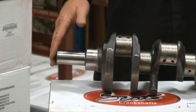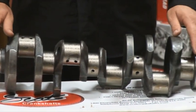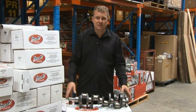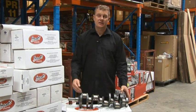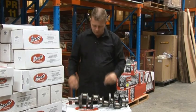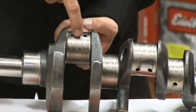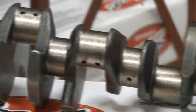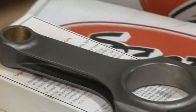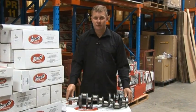This kit here actually takes a 302 Windsor up to 347 cubic inches — that's nearly 50 extra cubes. They increase capacity with a different crankshaft because they increase the stroke: the amount of travel the piston moves up and down in the cylinder bore, by increasing the distance between the centerline of the crankshaft and the actual journal, which also increases the leverage point. It's not uncommon these days to see a small block engine taken up to beyond 400 plus cubic inches, and you wouldn't believe how much difference that makes to engine torque and overall power production.